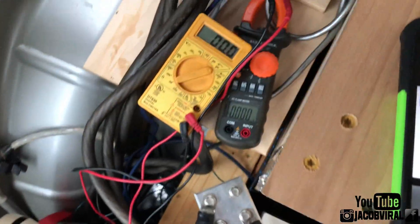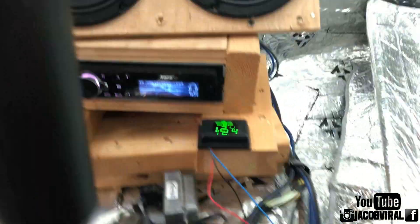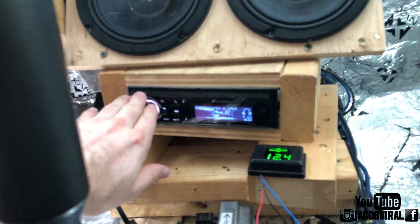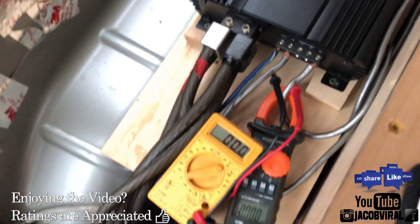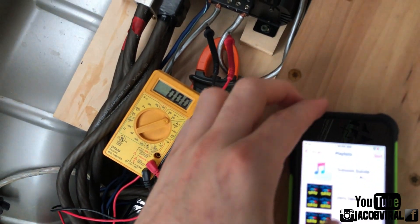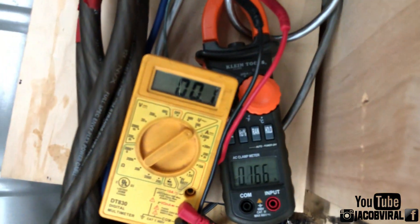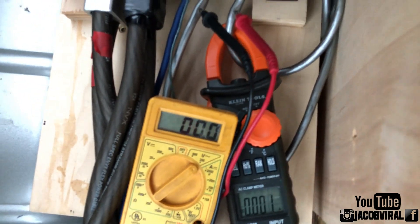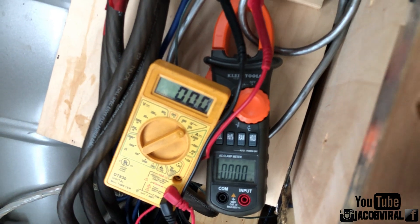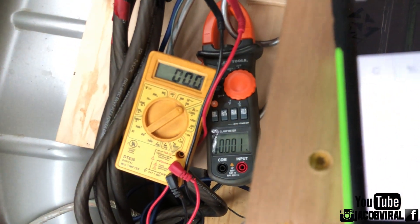I know that my rise is actually not too bad for peak frequency sealed — that was actually pretty good. Let me roll the window down. Just out of fun curiosity, back to volume 20, I'll do one more at 44 hertz instead of 43. Readings come out 0.9 and 0.6, so 0.9 divided by 0.6 — one and a half rise. I'd say around one and a half to one and three quarters is my rise around peak.